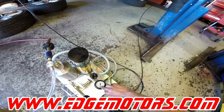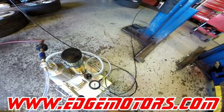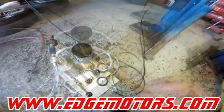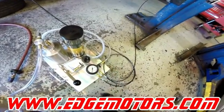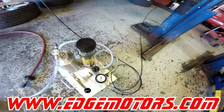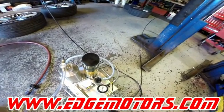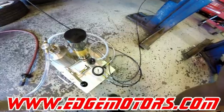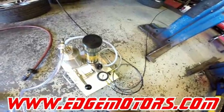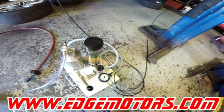It's got to be almost negative one bar for it to be a proper vacuum before you can start sealing the system. We have enough vacuum in the system now. We're gonna wait a couple of minutes to see if the vacuum is dropping. If the vacuum is dropping, you've got a problem — you've got a leak somewhere. Alright, we've been waiting a couple of minutes and our vacuum doesn't drop, so the system should be alright.